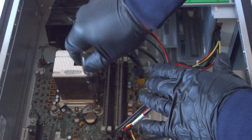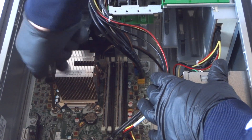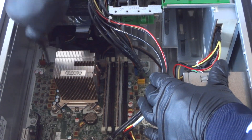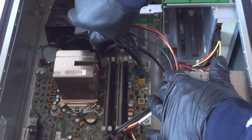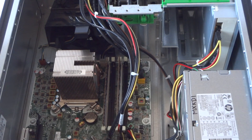Make sure to check all the screws on each side and make sure they're tight and not loose. If the screws are loose, the heatsink won't make proper contact and the processor could overheat. Check each side — make sure they're all tight.